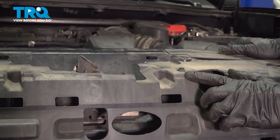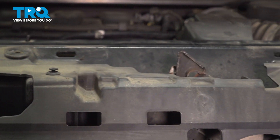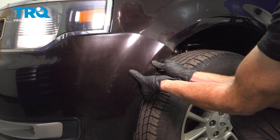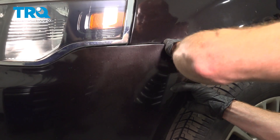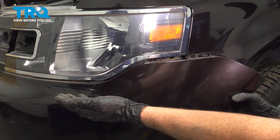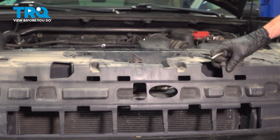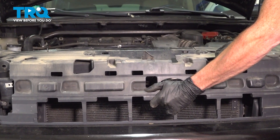Looking in the center along where your hood latch is, you're going to find two more push clips — do not remove these yet. Make your way to the corner of the bumper cover. Grab onto the bumper cover here and give it a little tug; we're trying to separate it from the fender. Make your way across along here. Once you have one side separated, do the exact same thing on the other side. Then make your way to those center push clips — these are the last things holding the bumper cover to the vehicle. Take hold of the bumper cover and remove it.